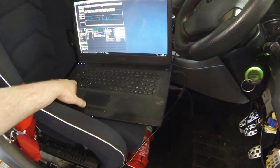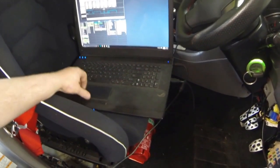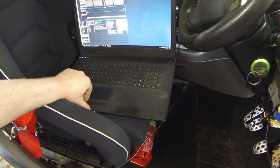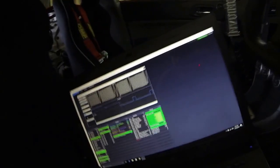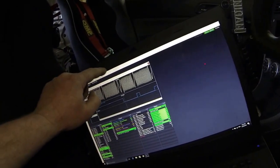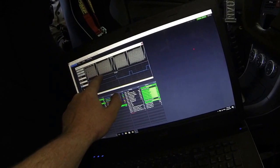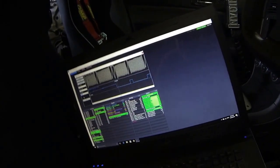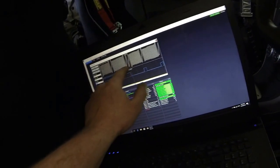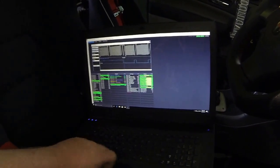So we can just go capture — that's what we're seeing right now. I'll get the divisions right: try 2 volts per division, and space the timing divisions out a bit further as well, try 20. That's basically crank angle sensor on the top and cam angle sensor on the bottom. The way this is set up, it's looking for a falling edge — as the AC voltage goes up and down, when it falls over the predefined limit, that's what it uses to count timing. There are a number of evenly spaced teeth on the crank pulley with spacers, and the missing tooth is what allows the engine to know its position. That looks alright, so we can close that down and now check the timing.